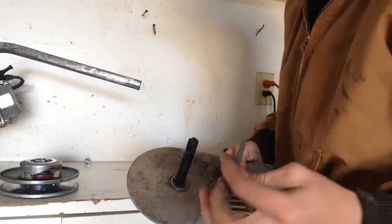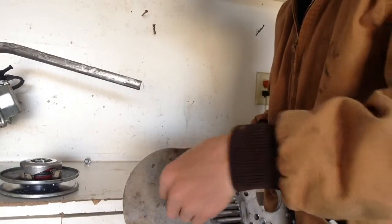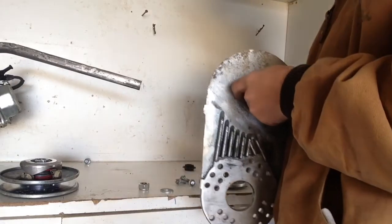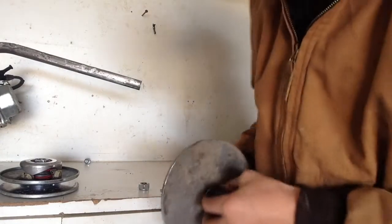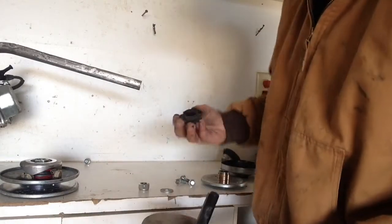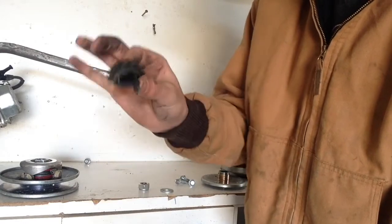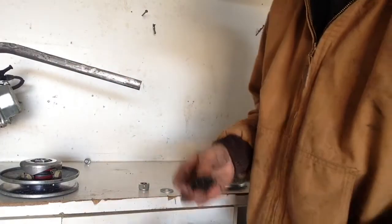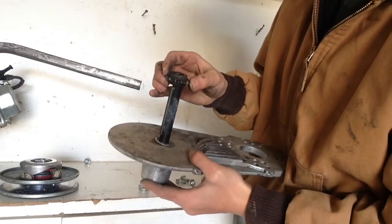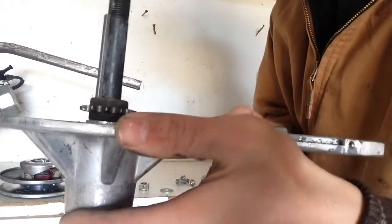So you're going to slide that over. Then you're going to take your key, put it right down in the key slot, slide it down in there. That should go in really, really easy. Now, once you've got all that, you want to make sure your key slot is there. Now, mine came with a 41 or a 35 — I have a 35 — so we're going to slide that down on here like so, making sure your key holes are lined up. And there you go, your sprocket is on.